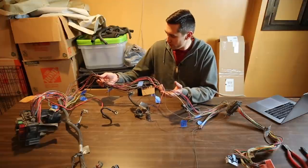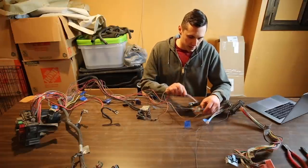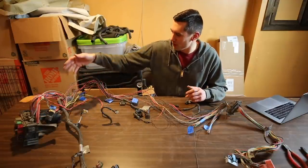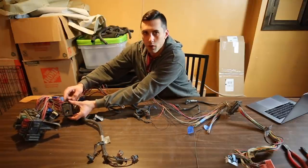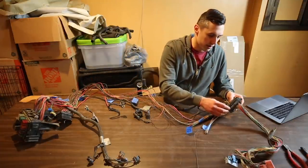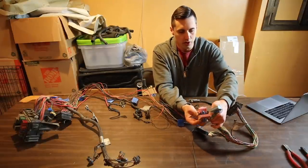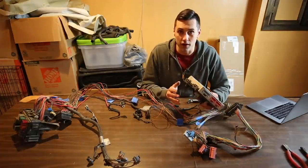What's left in the middle is mostly stuff that's going to stay in the vehicle. You can see these went to the transmission and this bundle of wires went to the engine. Over here is the engine compartment fuse and relay box — that's going to stay in the vehicle and supplies all the power. This connector goes through the firewall on the driver's side, and this one goes through the firewall on the passenger side. I still have a bit of work to do because these three connectors go to the GM PCM, which is not staying in the vehicle. I should probably talk about what I'm doing as far as the computers.